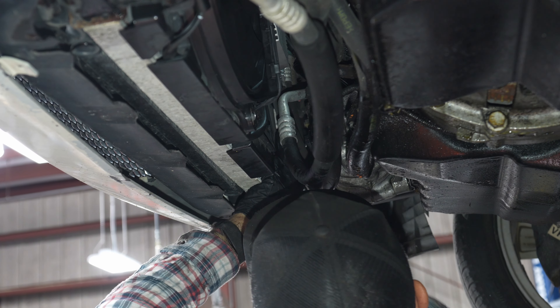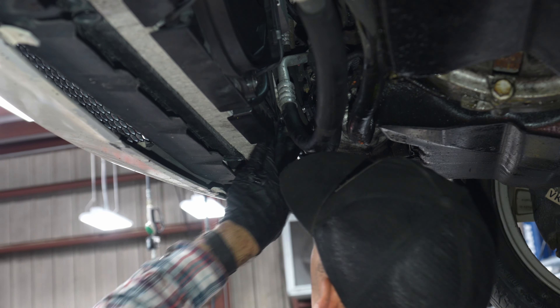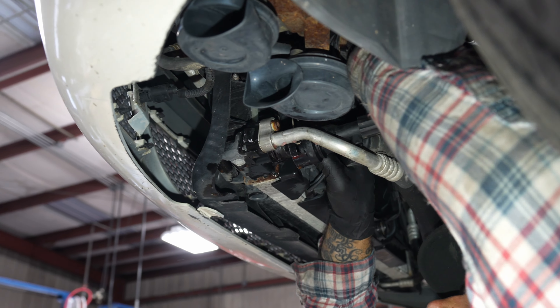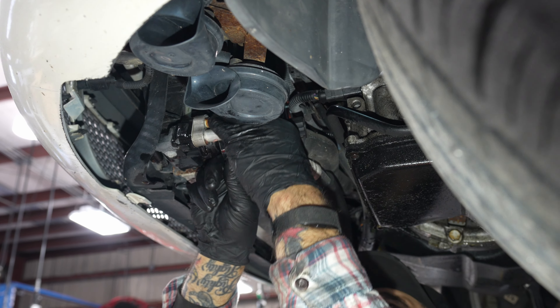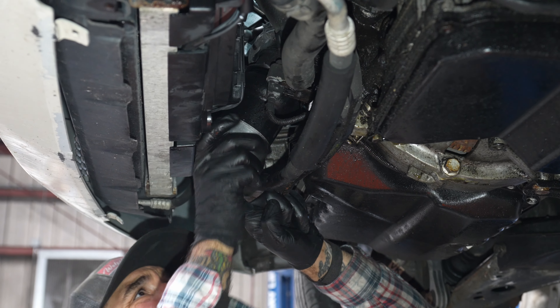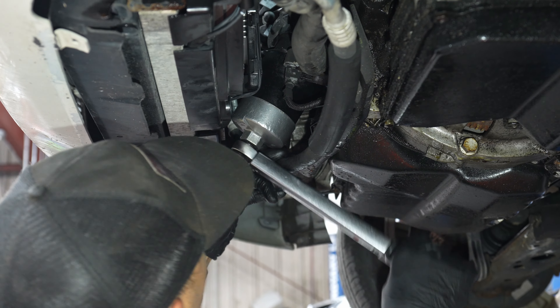Passenger lower T30 — you have to do it by hand. Lower T30, driver's side. Connecting the fan harness. Connecting the lower radiator line. Putting the oil filter back on — 25 Newton-meters.